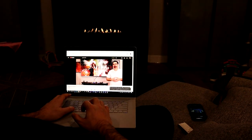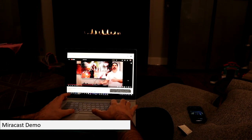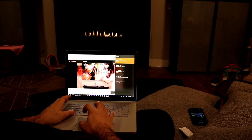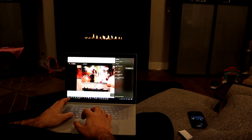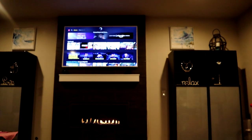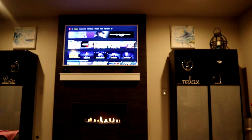Okay. If you have a Windows or Android device, you're gonna use a technology called Miracast. For Windows, I can hold down the Windows and hit the P key. It brings up this UI here, and if I say connect to a wireless display, you'll see it scan for displays, very similar to what the phone did. There's the frame showing up. If I click on that, and then we go up to the screen, we'll see that it knows which device is connecting and it's notifying.